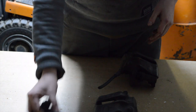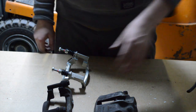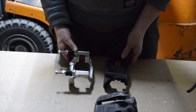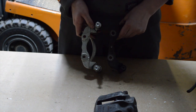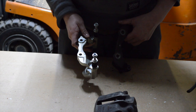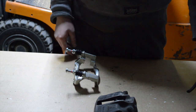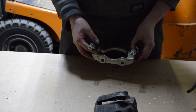That's why I replaced those with one of these — these are my new caliper carriers. They look a lot like the same, but they have one big difference: the distance of the holes. This one is 90 millimeters and this one is 75 millimeters. This one is actually from a Scirocco Mark 2 16 valve. They are pretty rare to find, and I bought these ones from a Kai in Germany, with new bolts and sliders in the package — that was around 140 euros.